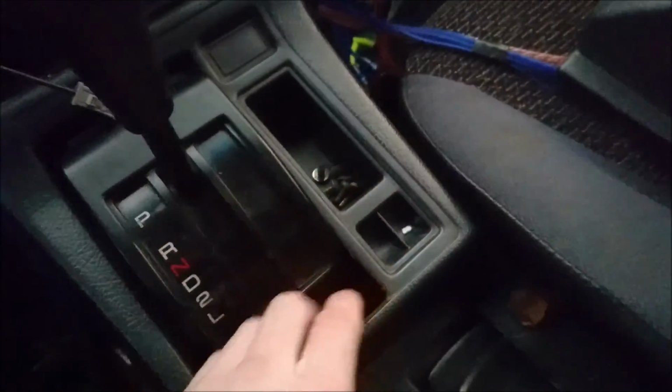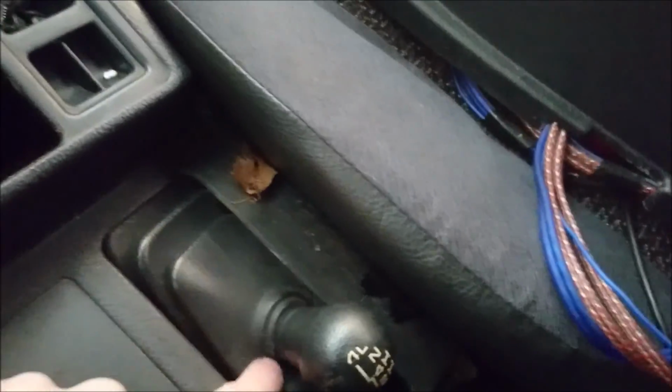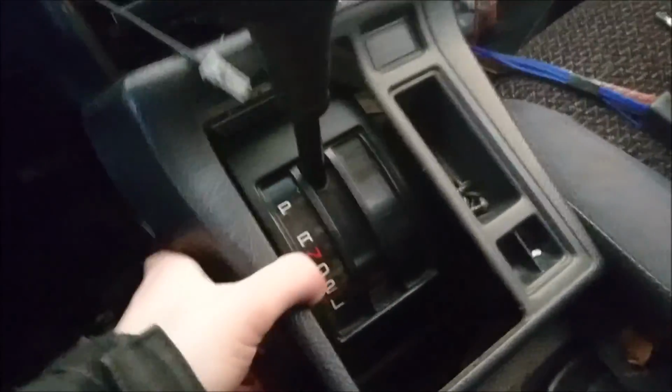The cup holder, it's pretty easy. One screw there, one screw on the other side, lifts out. This front section, one screw there, one screw there. Then after that, you can lift this completely out, sink the boot in for the four-wheel drive right there, down like that. Leave this hanging here.